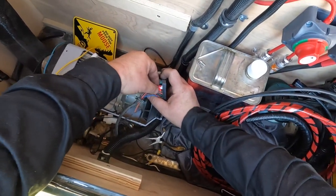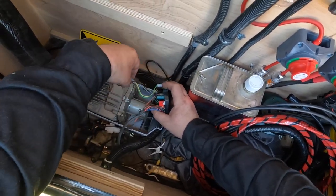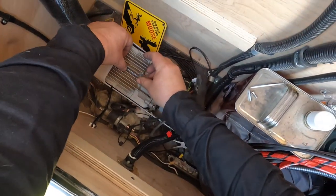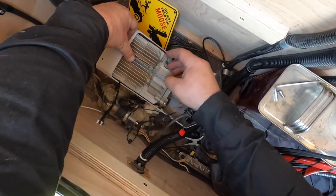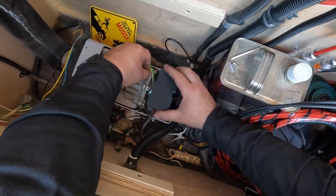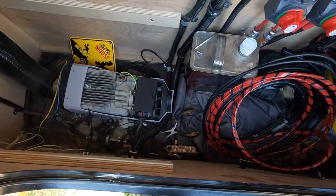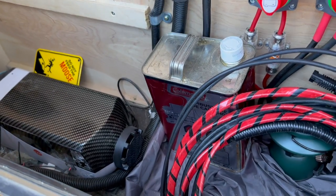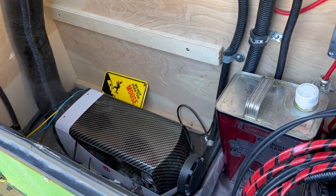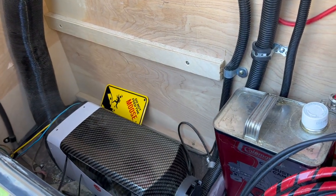The motherboard has a couple of tabs you need to squeeze together to lift it out. There are three connections — you've got to make sure the two wires are on the board. Put the donor temperature sensor in, make sure the wires are plugged in, drop it back in place. Powered up — so far nothing wrong. Another project taken care of. I think the trailer's finished.